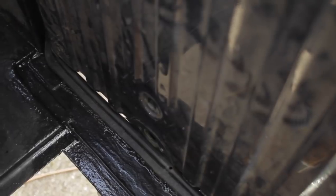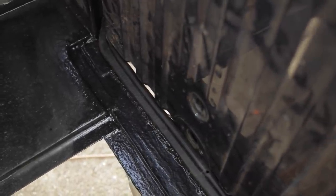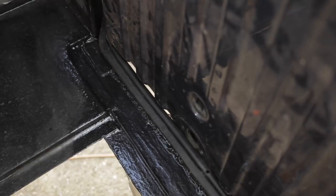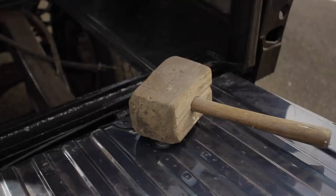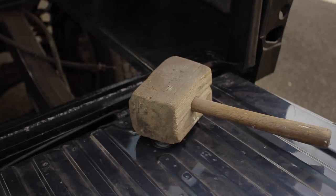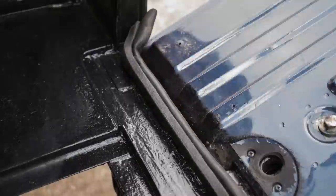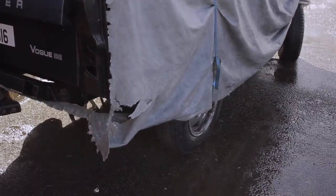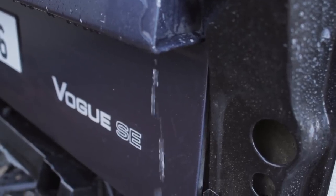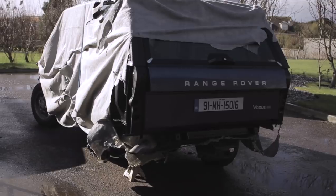But we do have an issue — our seal is not meeting the tailgate. I spent quite a while trying to figure out why. It's tall enough, the same as on the other car. I thought maybe it's just too far in, but I know it overhangs the rear crossmember to the same degree as the old one. I got the persuader out and eased the new lip aft to try and help the seal meet the tailgate. The situation improved, but we're still not right — there's something I'm missing. The fun and games were curtailed by another blast of rain, but it was great to see water coming off this lower tailgate knowing the car is getting very close to being watertight by itself.